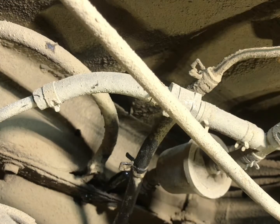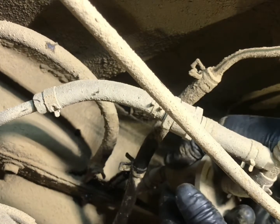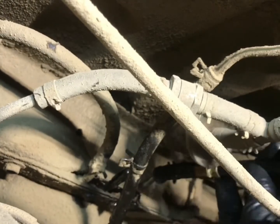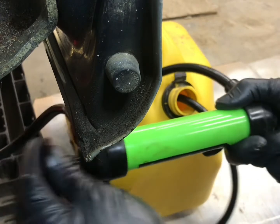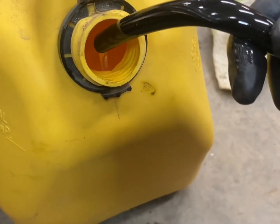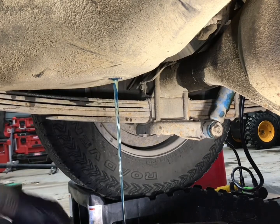Pulling the clamps back, I'll just take off this filter from the main line of the tank carefully so I don't get diesel in my eyes, and I'll just cap that off for now. I've connected the transfer pump to the main fuel line using those reducers. Using the pump, I started to draw diesel out into this jerry can — opening it up to let some air in so it drains quicker, and once it started flowing it just kept flowing until the tank was pretty much empty. I'll just remove this drain plug and drain out any that's remaining.